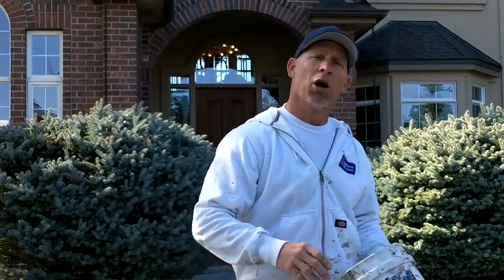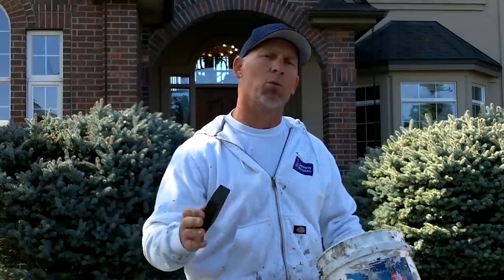This is Chris the Idaho Painter. In this segment we're going to show you how we deal with a run you get when spraying trim. We've got a run on a column and we're going to wet sand it, get the run out, and re-spray the column. If you get a run, the best thing to do is let it dry and then wet sand it, use Bondo and glazing putty to help get rid of it, and then reshoot the surface. Trying to brush the run out while it's wet could make it a lot worse.